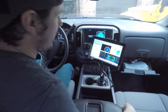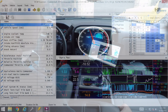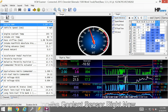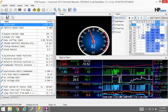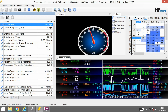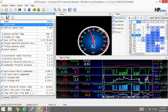I have a sneaking suspicion we're not getting enough airflow to pull the methanol across the sensor at idle, so I'm going to hold this up to maybe 2000 RPM and then inject it and see if that makes a difference. It may not like it because it's going to go pretty rich. That was about five seconds — didn't seem to make a difference, did not shift the needle. That was with the engine coolant temp sensor. Let's go back and put the intake air temp sensor in and try it the same way.